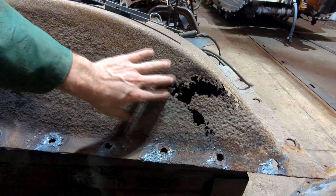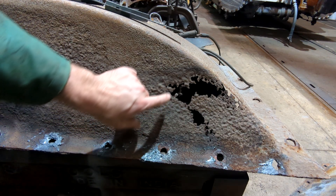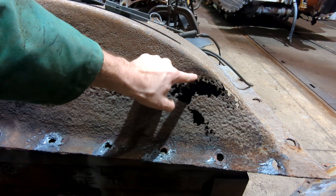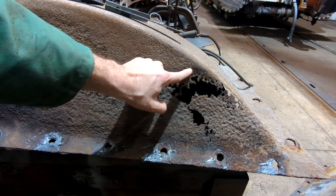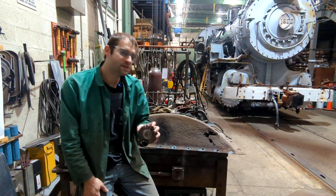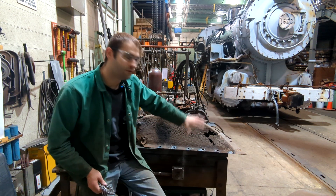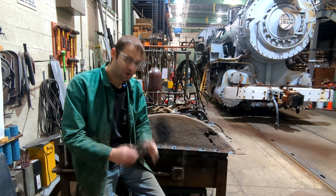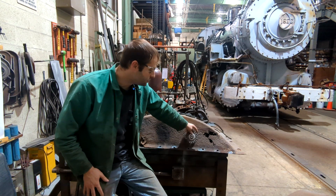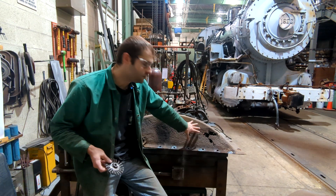When I replace a piece like this I'm going to cut around the area I'm going to remove. The biggest tip I can give is that you don't cut really close to the thin metal, because chances are the metal right above it is also going to be thin. I'll show a couple of techniques on how to identify how thin the metal is. One technique is a knotted wire wheel — if you run it over the metal you're able to see and take away material that's really, really thin, and it gives you a good idea of what you're dealing with.